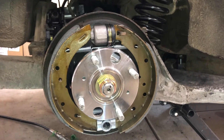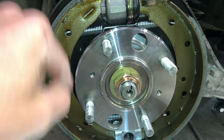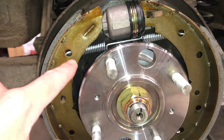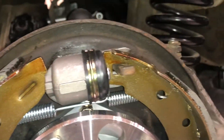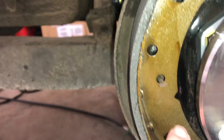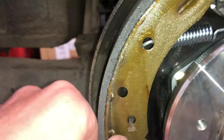Got the right side put back together with new pads, new springs, new cylinder, and a new adjuster to fix the one I broke — did both sides. Tip for putting these on: attach both springs to the pads while they're out, then fit one side in and stretch the other spring over. I don't think you'd be able to stretch them on while the pads are already in there, so it didn't take much effort to do it that way. When putting on the side opposite the parking brake, watch for the notch and make sure you're going with the hole just above it — if you flip it, it won't line up and you won't figure that out until you have everything back together. This is what holds the clip that keeps the pads in place.